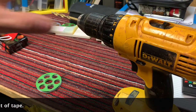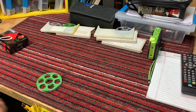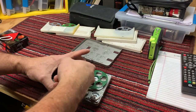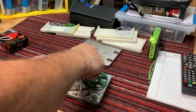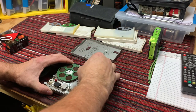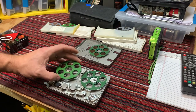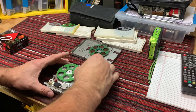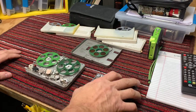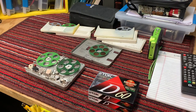Now we'll put the drill away and pull the Nagra out. The Nagra will use its rewind function to get the tape off this reel. We can just leave this spool on, take this other spool off - it's got fairly good tape on a metal reel. We'll put the reel we're going to fill on rewind, and then take one of these tapes. We'll splice a second tape to it. I need to show you the splicing procedure - let me locate my splicing tool and I'll be right back.